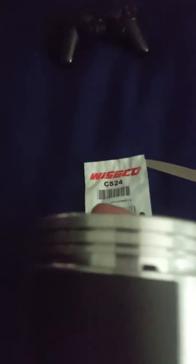I think they're 10-to-1 pistons, but I have a thinner head gasket for it, so it's gonna be about 10-and-a-half on pump gas — premium anyway. See the big coating on the piston? They're really fancy, really really nice. Pretty — you pimpin'.